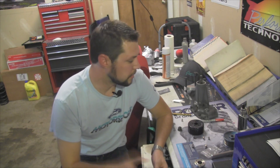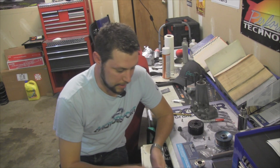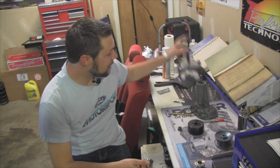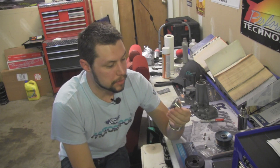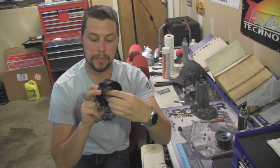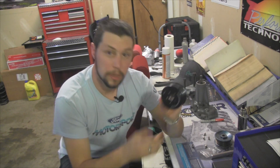I did that the last time I did this old pulley, so that's perfectly fine. I just kind of wish I hadn't spent the money buying it — I could have just rented it from ZZP. So if anyone needs a 3800 series supercharger pulley puller and installer, let me know because I have one for sale. This hub I got from Nathan Erbst is almost identical to the ZZ Performance pulley — fits right into the back of it, all the bolt holes line up and everything. So this is perfect if I want to switch to a larger or smaller pulley in the future.